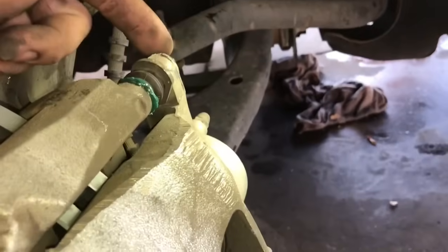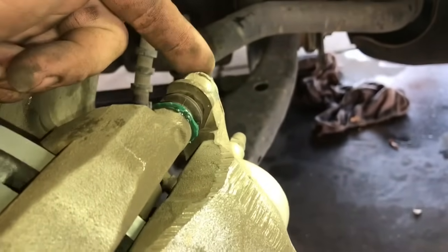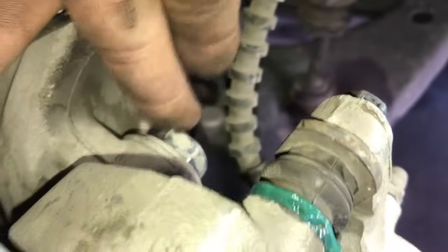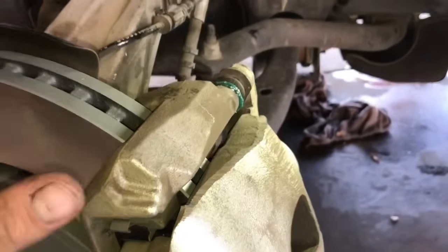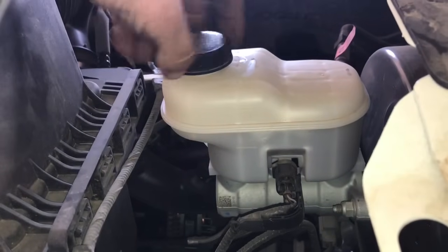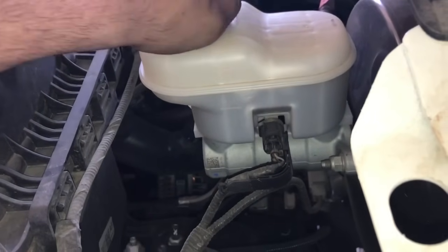As you can see, we've got everything mounted up. A couple quick notes on torque specs: 27 foot-pounds is the spec for the caliper guide pin bolt, and the caliper mounting bracket bolt — right here and down below — is going to be 136 foot-pounds. Go ahead and get those torqued down — very important to do that. Then go ahead and put your brake master cylinder reservoir cap back on and don't forget to tighten it down.